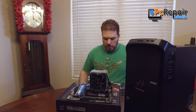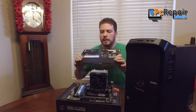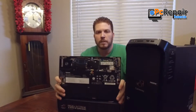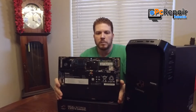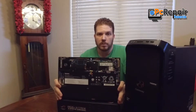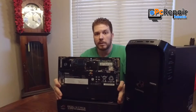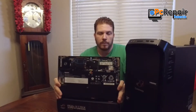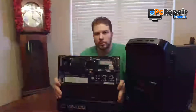Some machines, like this laptop here — this is a Lenovo ThinkPad, it's an Ultrabook — if you take a look you'll notice there's actually no place to upgrade the memory. So in this particular instance this machine is non-upgradable. However, some Ultrabooks that are still very thin do have the ability to add a single DIMM, and typically they'll have like four gigs of memory on the motherboard itself and then maybe another four gigabyte DIMM installed for a total of eight gigs.